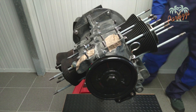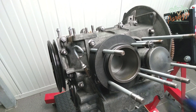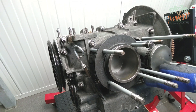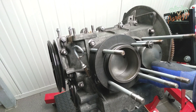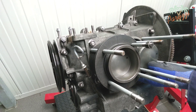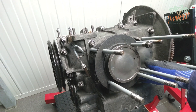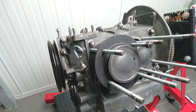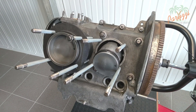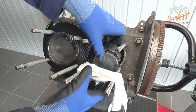Once a cylinder is disassembled, you should also carefully guide the pistons while turning the flywheel, as they could push against the crankcase and cause damage to various engine parts. Protect the piston rings if you want to reuse the piston, but that same protection can itself cause damage while turning the flywheel.